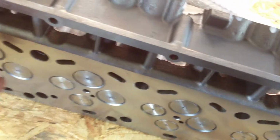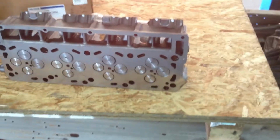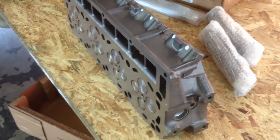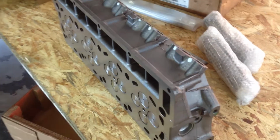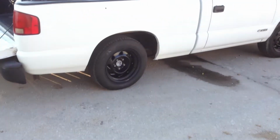They set the valves. The valves are all consistent. They're about 19 to 22 thousandths recessed, and they're pretty matched. So that tells us right there, if Ford says we can go 3.729, then the 3.74 means nothing. Now I got more. Not really trying to make a big bash session, but we got right here, okay?